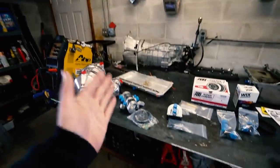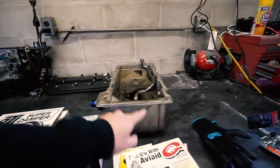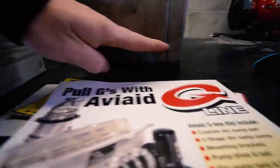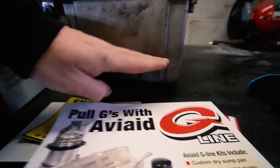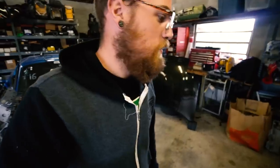The other key component here for me is this is your pan - you can see how it's shallow front to back. Obviously this is my wet sump pan. This pan hangs down about this far below my subframe, so it is the lowest point on the car. If I were to drop a tire on the inside of a rumble strip or anything like that, I have a high probability of cracking the pan. I ran my car super high, but it's still not really a guarantee I'm not going to crack it. And if I crack it halfway across the country, it's going to be kind of hard to replace - the motor's going to come out. So to me, the dry sump just made sense. It checks all the cool boxes for me.